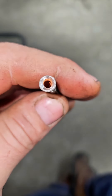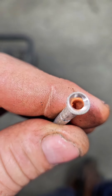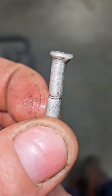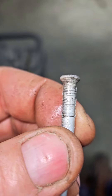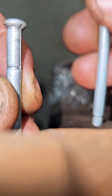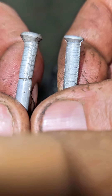Here is the flare from 2024. As you can see, the center of the flare is a little lopsided. I mean, this would still seal, but it's not as nice as the other one, that's for sure. And even the flare itself — look at the way it squished it. I think there's a big difference between the 2024 flare and the 1953 flare. Let's put these flares together so you guys can see. 2024 versus 1953 — look how much nicer that is. Same line, same everything. Just doesn't even compare.